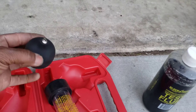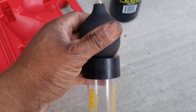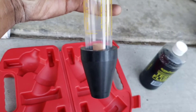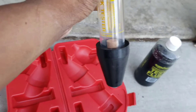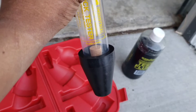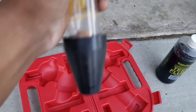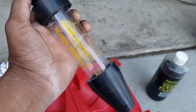And then you have this little ball right here. Stick this ball in the back and then you pump it. As you're pumping it, it's sucking up some of the air out of the radiator. And once that air touches that fluid, if it has combustion gases in it, it'll turn that fluid yellow. So it'll go from a dark purplish blue to a yellow. You wanna keep your fingers crossed and pray to God it don't turn yellow, or you got head gasket problems. So I'm gonna test mine right now — I just want to make sure my head gasket is fine before I waste all that money to go get it tuned.